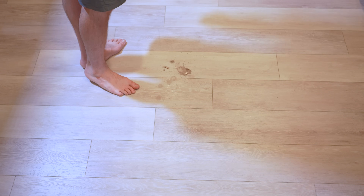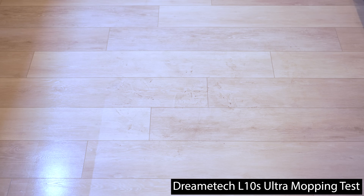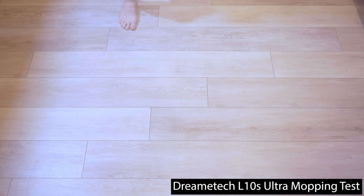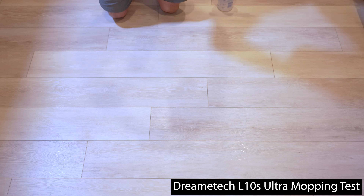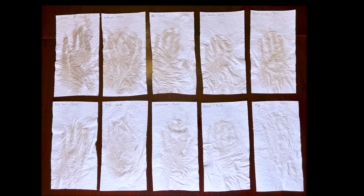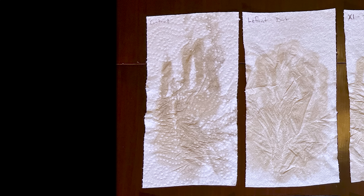To set this up I made a solution of floor mud and spread three milliliters of it on the floor. Then I used a hair dryer for five minutes to completely dry the stain onto the flooring and let it cool down to room temperature. I set all the mops to medium water flow in two passes and started a specific room clean for just the kitchen. After the cleaning I did two even sprays of water through the testing area, wiped it clean with a paper towel, and judged the mopping performance based on the amount of leftover dirt on the paper towel. For reference I also included a paper towel wipe done without any mopping and one done after manual mopping with floor cleaning solution.